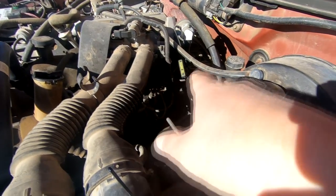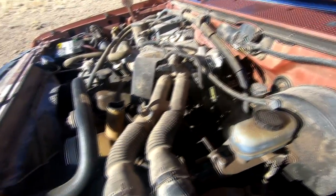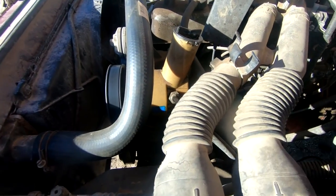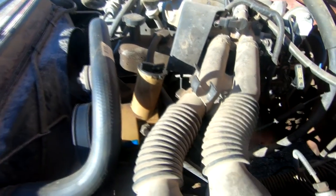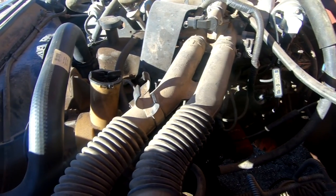I thought I'd get out here and take care of maintenance on the truck. There's oil residue or something on the side of the engine — it's not exactly clean like I like it. I've had a problem with the power steering pump leaking right here at this little fitting because the roads are just so bumpy they're shaking everything loose. I'll take some engine degreaser, squirt it down the engine, run it over and blast the degreaser off with a hose, and clean this up. We'll check it out tomorrow.